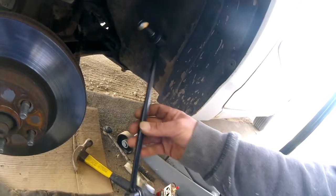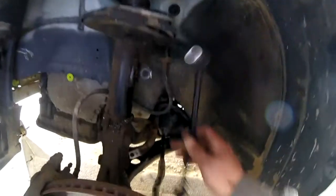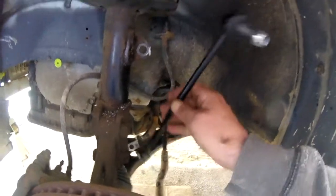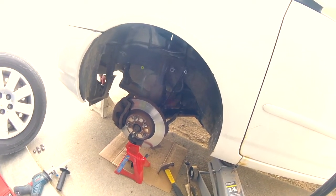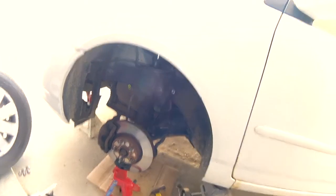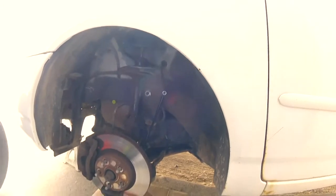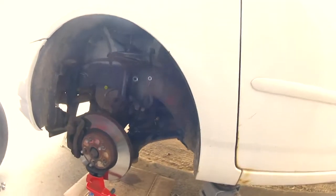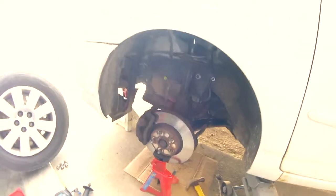This is the stabilizer bar. It goes back into place like this. We'll have to play around with a jack underneath this and moving so we can adjust this difference down. So by putting that jack stand underneath the hub there, the brake rotor, we can lower the vehicle down until we're pretty much even up on the top, because let's go a little further if we can.